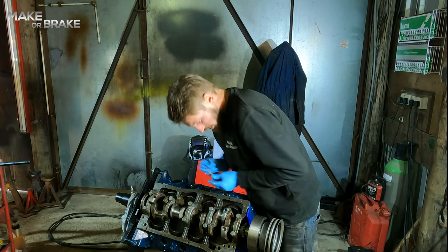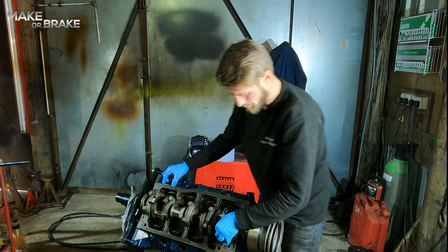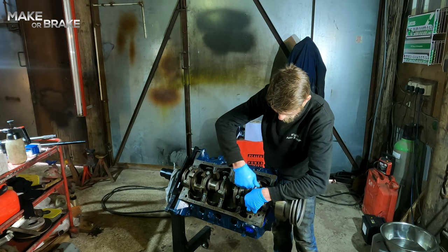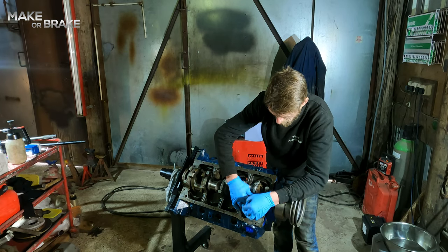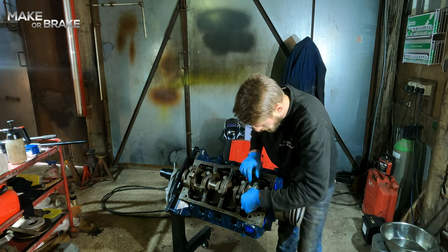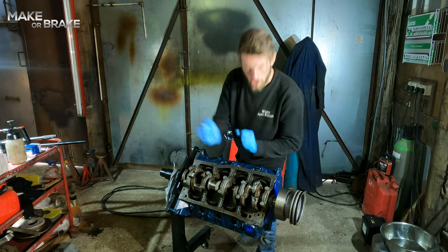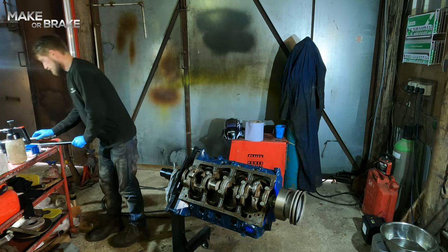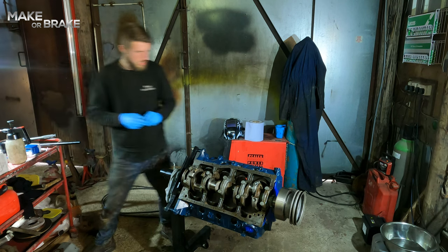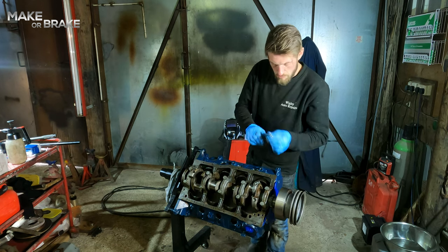Like so, hover your bolts in. And much the same with your main caps, you want to wind them both down equally, make sure that they seat down both at the same time, so that when you torque your bolts, you know that you're getting a true torque rate and you're not pulling one up more than the other. For a minute, I'm just going to wind them down by hand. So now, 11mm 12-sided.